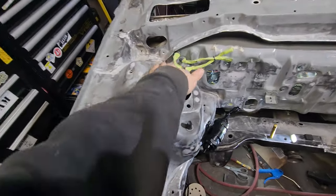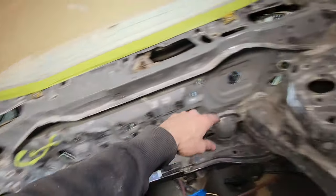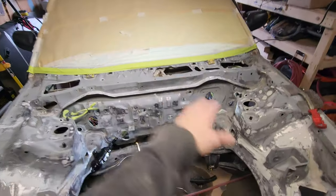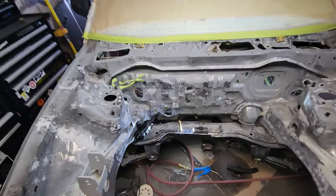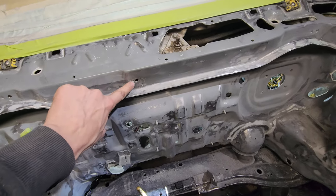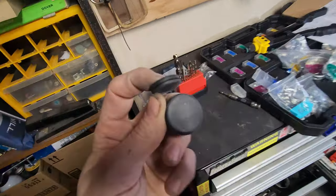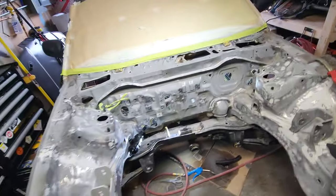I'm done with bondo today. I did quite a bit - the only thing I really have left is this spot here, a couple spots here, finish right there, and figure out what I'm gonna do about this. I don't really care too much about this spot because the windshield washer motor will be there. Over here I've been working on smoothing this out a bit more. It's tough doing some up here standing and squatting down to do some down there. I took this off so I have to grind this down, and I may just use my little rubber plugs to fill in these holes.